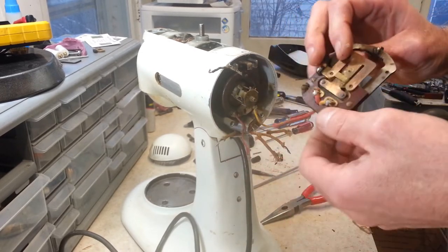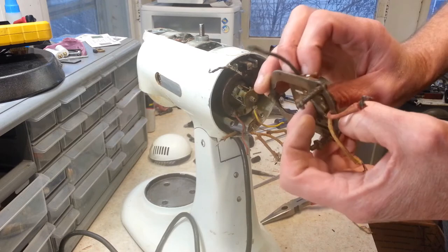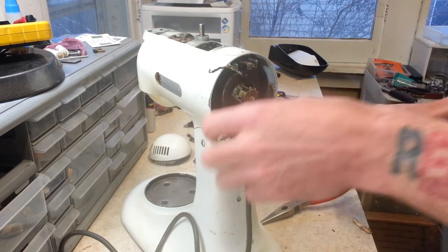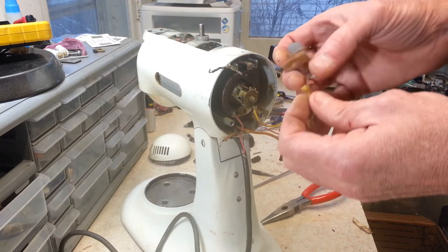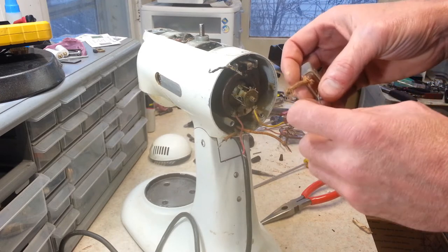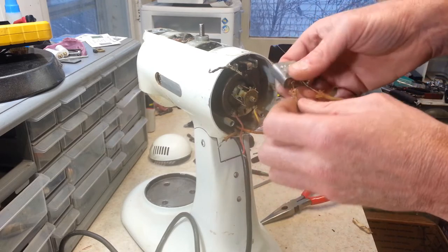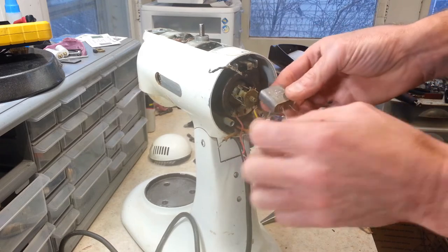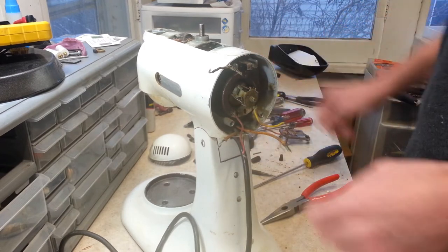This is our speed control. The contacts are right here, and they're still intact. Alright, here's the capacitor. So this just has wire leads coming out of it. It looks like this did have a coating on it. This did have insulation on it. Alright, so we'll just take these off here and just cover that with heat shrink. I got some small heat shrink that we can put on there to cover up these leads, being that these are pretty difficult to find. But anyways, that's that issue.